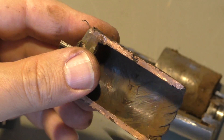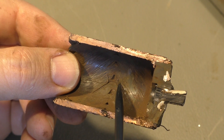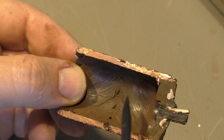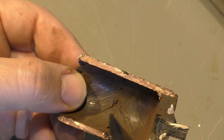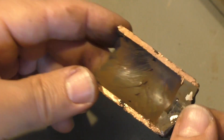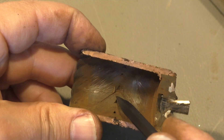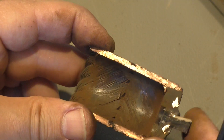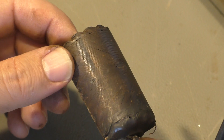When this is rotating and there is rust somewhere, it distributes evenly everywhere. We also see here a broken wire — most likely because the ends are blank and polished, so it broke by rubbing against the magnet due to debris and rust, which made the motor stick. I managed to make it turn, but with a broken winding and that much dirt inside it wouldn't last long. Buying a new motor is not an option anyway since I don't need the drill.